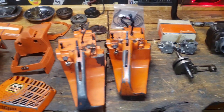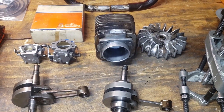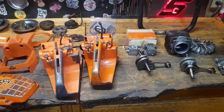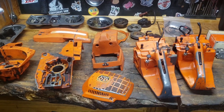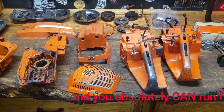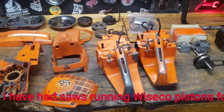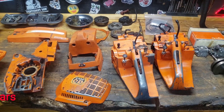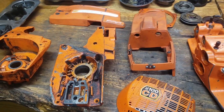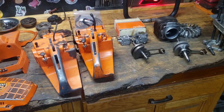I'm going to make a two-piece head for it and I do have to find what piston I'm going to run. I want to run a Wiseco piston — the forged Wiseco. I've been using those pistons since my dirt bike days, 25 years ago. I really love the Wiseco pistons; they are an amazing company. Some of them go from double ring to single ring, they'll have a pop-up, they make their skirts different lengths to help timing — they're just really good pistons. They're expensive, over $150 just for a piston, but well worth it.